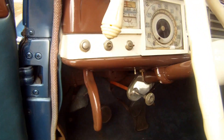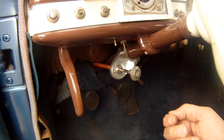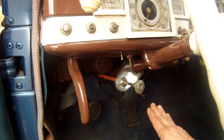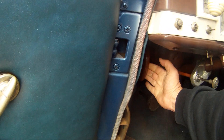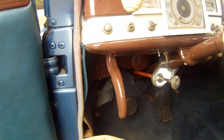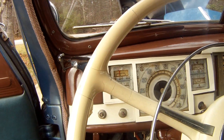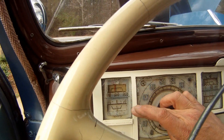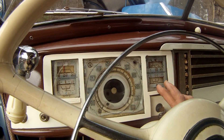This car has an overdrive transmission — you pull it and it shifts in and out of overdrive, and that works. Brakes are good. The clutch seems to work well. The emergency brake holds very well — it's tight. One of the remarkable things is that every gauge in this car works: the temp gauge, the amp gauge, the oil gauge runs about 40 pounds hot at idle, and the fuel gauge.